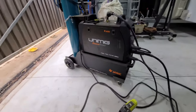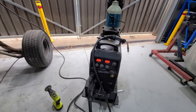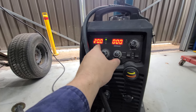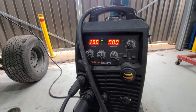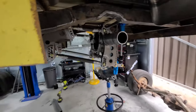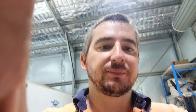This is the devil welder over here. Before when I was welding the thing wouldn't weld — I had to have the wire speed up high, and then I had to have the voltage up around like 24, 25 just to get the thing to weld. I just wish I'd picked up on the problem a bit earlier, but it's all good. I'm going to pull the diff out now and get started on running the welds off and redoing them.